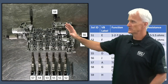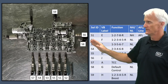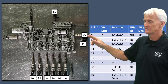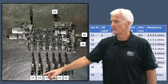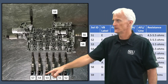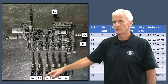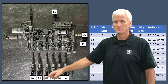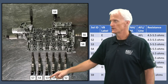On this illustration, I'm showing the location of the different solenoids. We've got S9 and S8, which are two on-off type solenoids. S6 is our line pressure solenoid. Then we have S1 through S5 plus S7, which is the torque converter clutch solenoid. S1 through S5 are the ones responsible for their respective clutches — the S4 solenoid controls the C4 clutch, S3 controls the C3 clutch, and so forth.